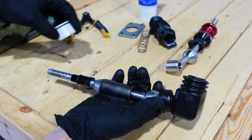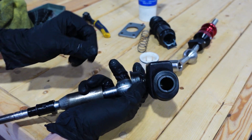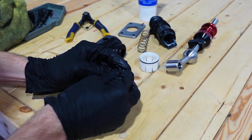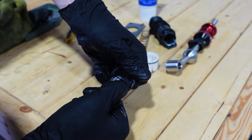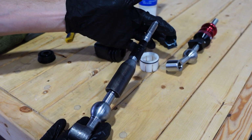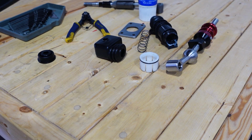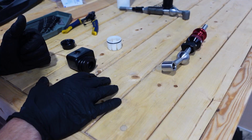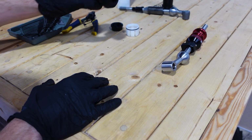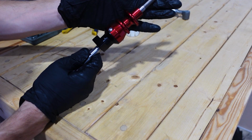And the reason I'm wearing gloves is because there's white lithium grease all over this thing from factory, and it's really messy. Now we're gonna go ahead and pull the boot off. Okay, our factory shifter is disassembled. So all we're gonna need from our factory shifter is this plastic ring, both of your boots, and this metal plate. Set them aside, grab your BilletWorkz shifter.